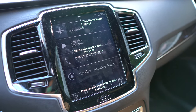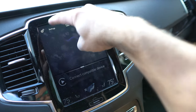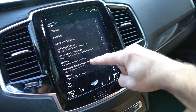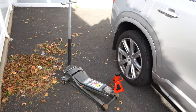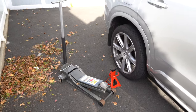You should also make sure your parking brake doesn't automatically apply — you have to do this from the car. Start the car, go into your settings, go into my car, then parking brake, and make sure this box is not selected. This job also cannot be done without a jack as well as some sort of a stand to back up that jack.